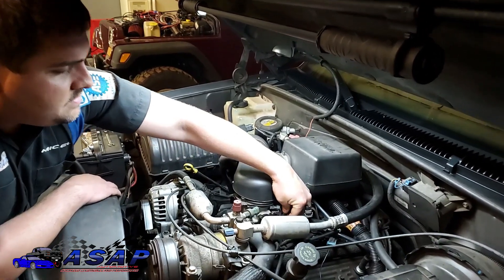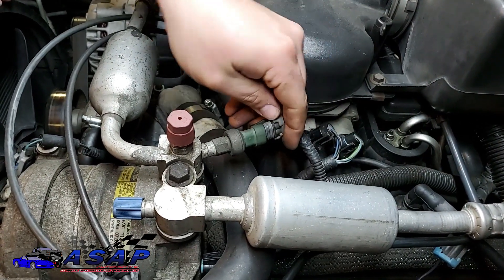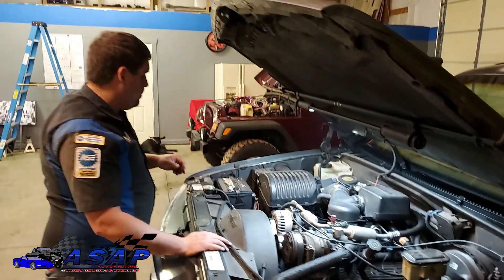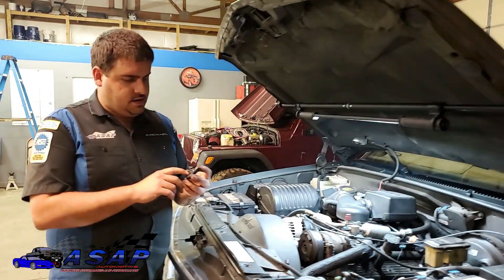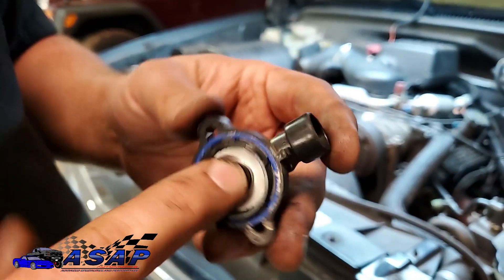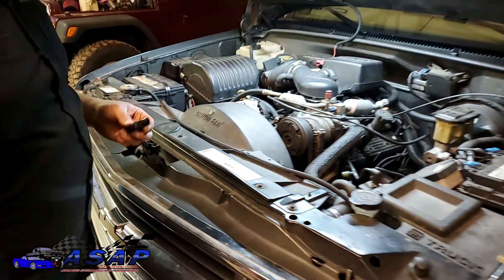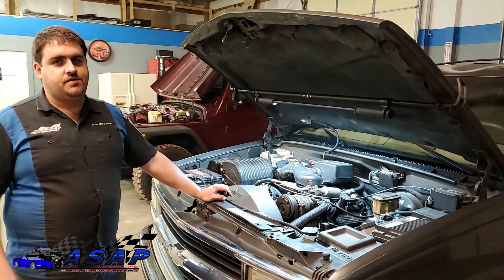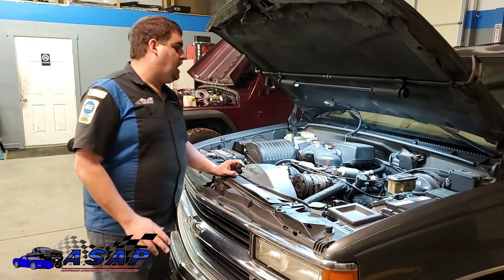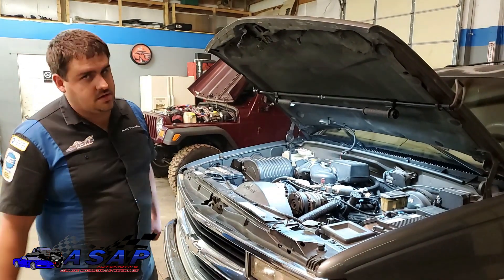Always make sure those connector seals are in good condition. Let's go ahead and plug this stuff back up. We've got our idle air control plugged back in, TPS plugged back in, and then our high pressure switch on the AC. Now we can go ahead and reconnect our negative cable on the battery. Looking at the worn-out old TPS — this thing is totally shot, just flopping around there. It was wanting to upshift into overdrive and lock the converter up way too soon. I'm going to go ahead and hook the scanner up real quick and give you guys a visual of what I was talking about when diagnosing a TPS sensor.